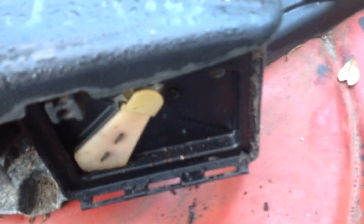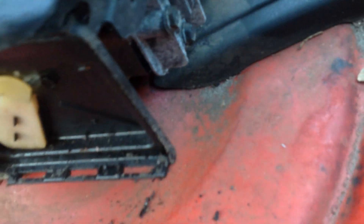The inside of the air filter cover is also filled with debris. The carburetor doesn't look bad from here — there's not a lot of build-up at the carburetor opening. But I'll still do a carburetor clean on it just to make sure. This is an automatic choke system; there's no primer bulb in the front.